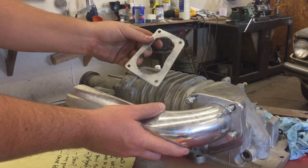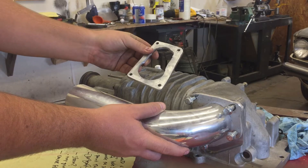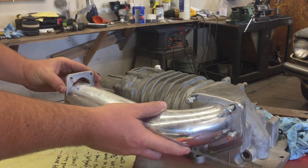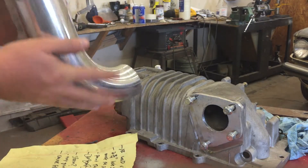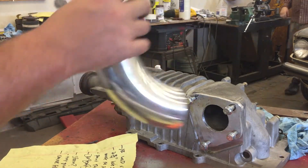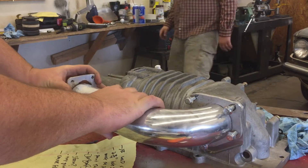We're hoping the weld will hug it nicely. We could cut a little higher, but the higher the cut, the more oval it's gonna be, so maybe just about an inch. Then this other piece — it's not done yet, you can see it looks a bit rough — but this is shaped to match the throttle body, so it's gonna go on the end and we'll squish this round end down so it fits right in the middle.